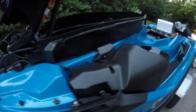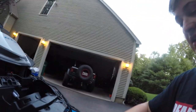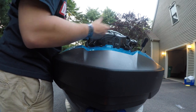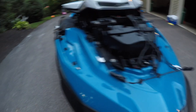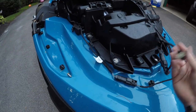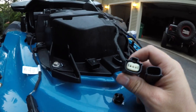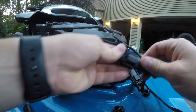Now repeat that step on the other side. Once we have our speakers in place, we can connect them together with these two wires — a three-pin and a two-pin. We connect those together, and then as you can see, there's a little placeholder electrical connector here for the speaker. We take them and connect them together. Now our speakers should be able to get power.